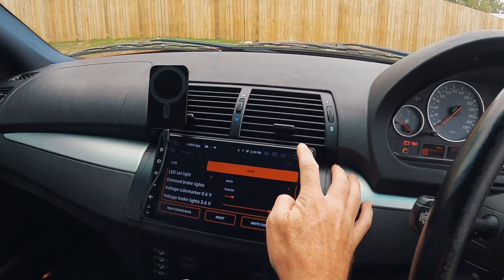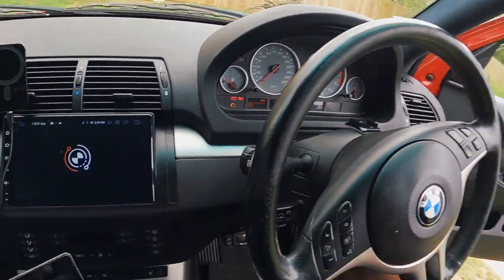Basically with the tail lights on, we get much less flicker when I've got it set to FF, which should be a hundred percent PWM signal. I was sort of happy with that. Then I started the car up and the flickering when the engine's running is about the same as what it was last night. Long story short, back with my old car I didn't have PA software — we were doing lots of settings in NCS Expert, did everything we could, and I spent like months messing around with that thing. I eventually ordered some capacitors. I fitted those capacitors to my car and it didn't fix it. So I removed them and I'm starting to think maybe I just cocked it up. We all make mistakes, but I just want to show these capacitors quickly.